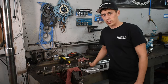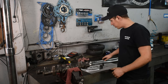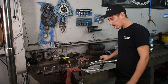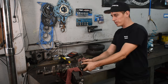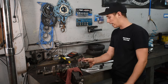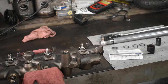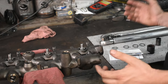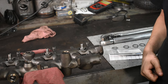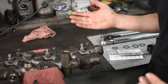So to replace these oil rail seals, you're going to need a couple of things: an oil rail socket, a half-inch or three-eighths drive ratchet — these are on there pretty tight so I like to use a longer ratchet — a bench vise or something to hold it solid. These are torqued to 100 foot-pounds, so you need to make sure these are really clamped well otherwise it will come flying out. You also need a torque wrench that goes to 100 foot-pounds. Make sure you have a clean work area, because any time you're working with the fuel system or the high pressure oil system, the last thing you want is to get debris in any of this. Most of this stuff is post-filtration, so anything you get in here is going straight into your injectors.